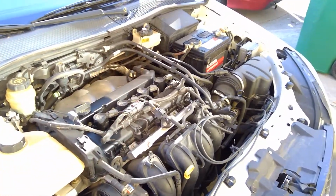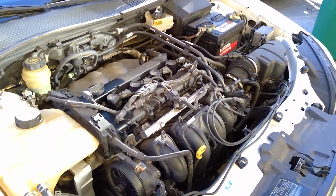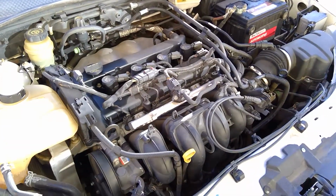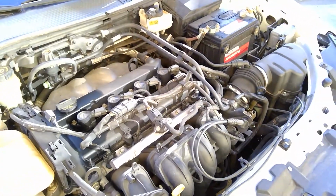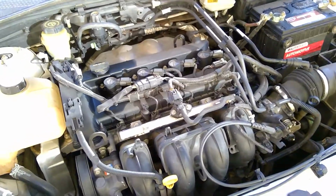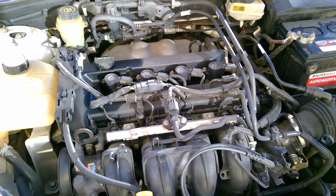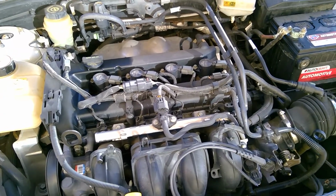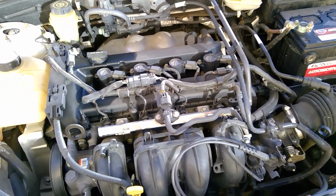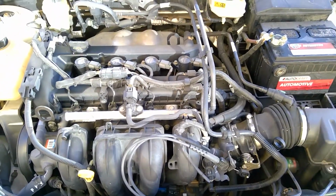how powerful is the engine going to be and how much is the car going to weigh. A lot of classes of road course racing, rally racing, things like that have horsepower to weight ratios that we have to build around. So let's say that I was in a class that allowed me to be 10 pounds for every 1 horse that the engine made. If the engine made 10 horsepower, then the car could weigh 100 pounds. If it weighed anything less than that, I would have to make the car heavier.